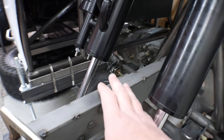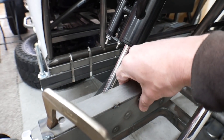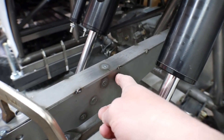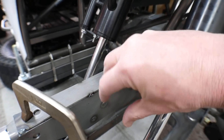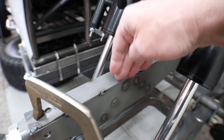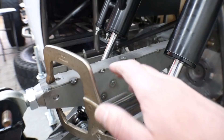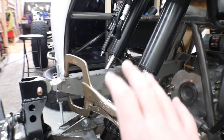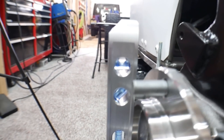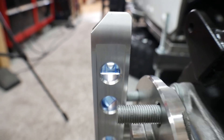At this point I've got the link in here — the top plate is tacked on, side plates are tacked on, and I've got a triangular piece in here just to give it some inner strength right where the bump stop is going to be hitting, just to add some extra support. I've basically sized it up where I want it to be and set it up with zero camber, starting from neutral.